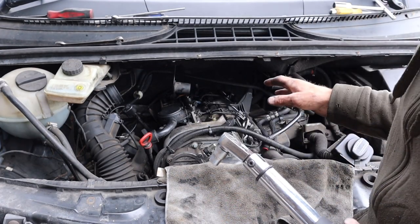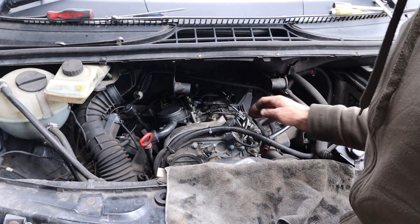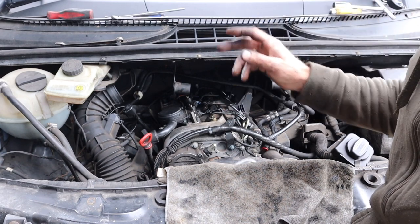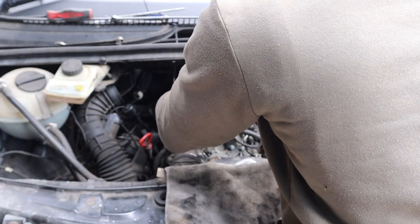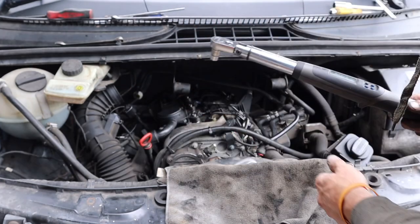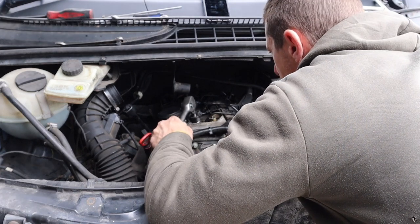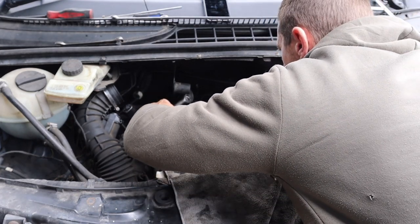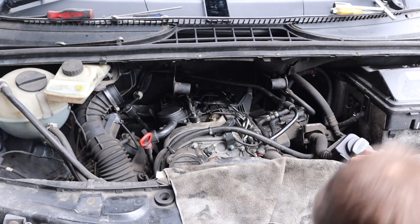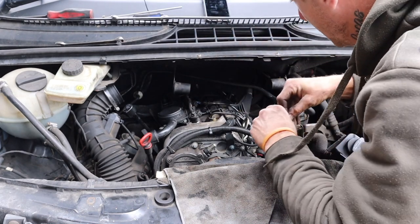Getting there, almost done. I've put the fuel lines on — just nipped these up by hand to hold them square — and I've clipped the wires back on. Just need to torque these up. On a Mercedes of this variety it's 7 Newton metres and two lots of 90 degrees. Put a little bit of grease on the O-rings on the return lines just before they go back in. Push them into place and give them a little tap with something heavy like a ratchet. Get your four clips back in — they are fiddly, so don't drop them.